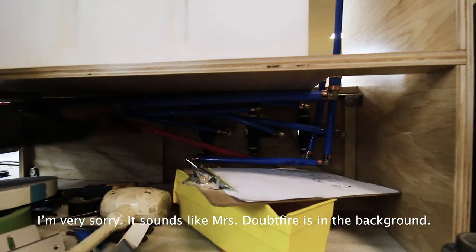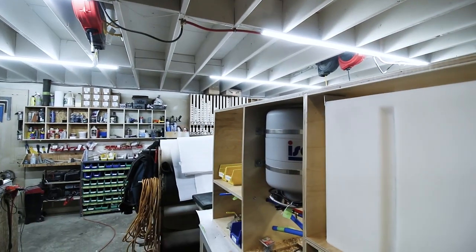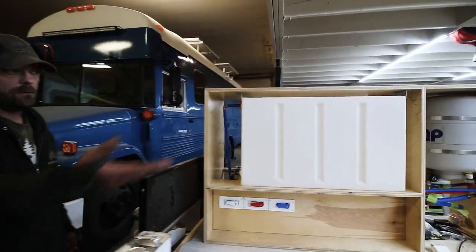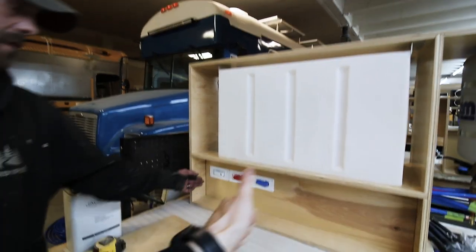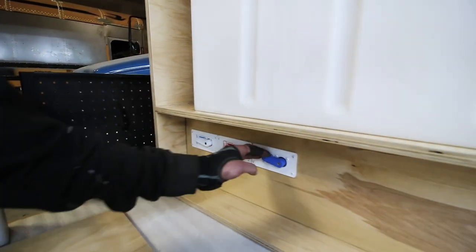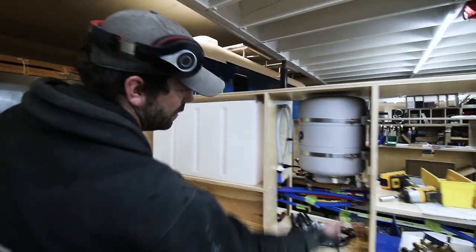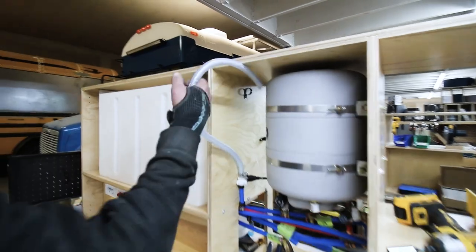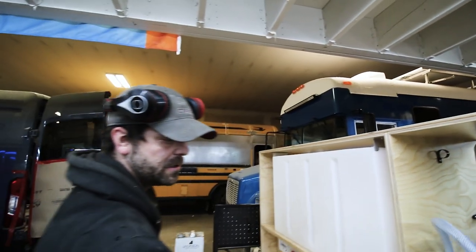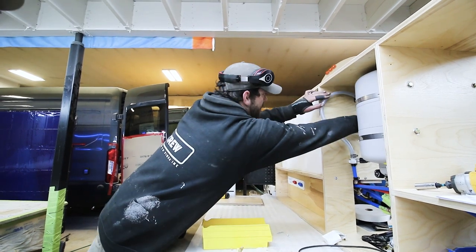These are your water diverting valves. So this is the back side. That's the hot water tank. This is what you will see. That is looking good. Winterization valve, hot water heater bypass, city tank diverter valve, all your controls. This is your winterization tube. Stick it in plumbing antifreeze so you can winterize your rig at the end of the year.